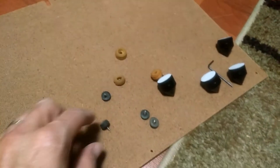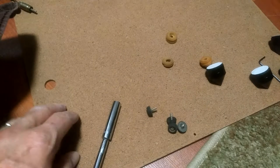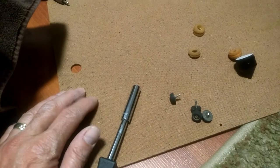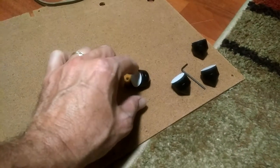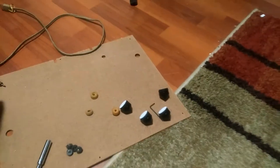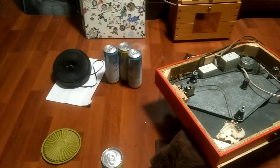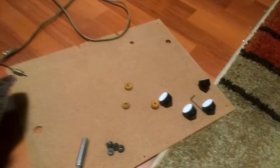These are the typical feet that come with the Thorens turntable with this kind of press board bottom plate. What I'll be doing is replacing that with either half or three-quarter inch MDF, as many recommend, to stiffen up the bottom side and improve sound characteristics. I'm going to replace the feet with conical feet, which are adjustable so you can balance the table. They have a rubber bottom and a little hole the cone fits into, which isolates the bottom — and here on a sprung table you don't really need it, but it's just an added bonus.